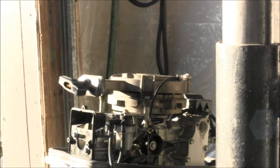For the Spirit outboard, which is a Suzuki, I ordered a 15 and it did not fit the Spirit. I had to order another one, and I think I ended up ordering an 18 horsepower Suzuki impeller, and it fit the 20 horsepower Spirit. So I have the 15 horsepower Suzuki impeller, still brand new. So I have an impeller, but first I'll need to take care of the broken stud and thermostat situation.